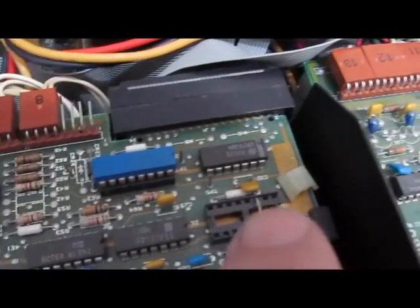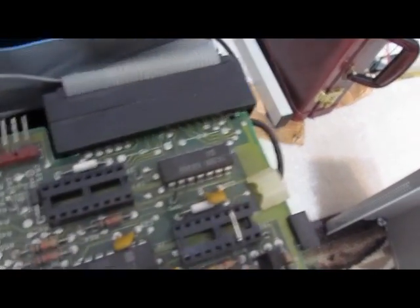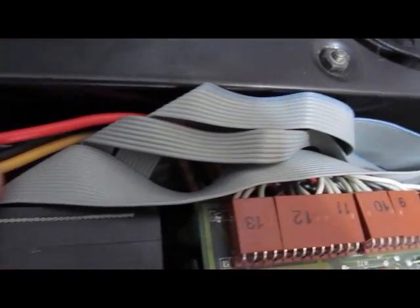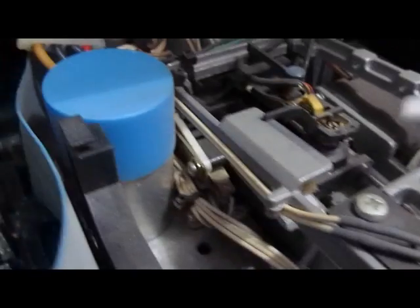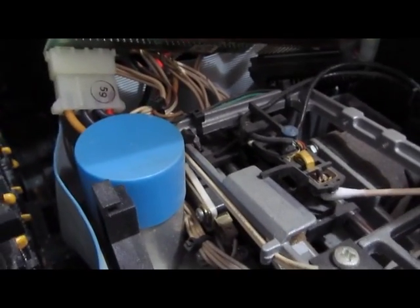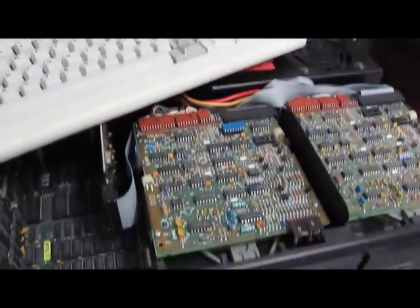Notice on the floppy drives how they've made up the jumpers here — a little swap cable. It's not done like this quite anymore. The next thing we need to do is clean up the heads since this PC hasn't been used in so long. I'm just going to take a little bit of alcohol. I've gone ahead and cleaned up the floppy drive, so the head should be at least clean now.